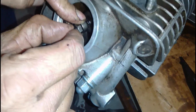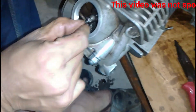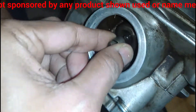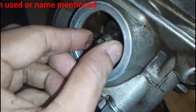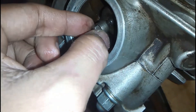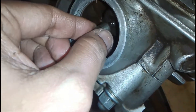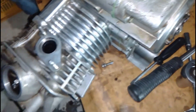You can see he is wiggling the rocker arm forward and backward to get the idea of how big the gap is between the valve and the rocker arm, and we are trying to adjust it. The most recommended way to adjust the valve is by a feeler gauge, but here I am trying myself to adjust the valve by wiggling it forward and backward and tightening it with my finger. It feels like something is moving or tapping, and when I feel that there is no gap in the middle I finally tighten it and just hope that it will run okay.